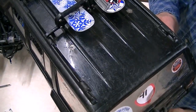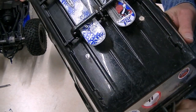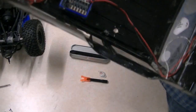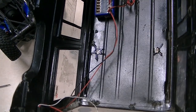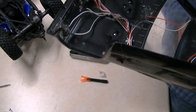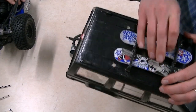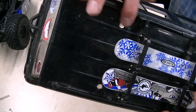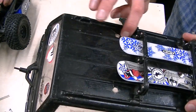Now you can see by the reflection shining off of that hole from the studio lights that there's actually material in the hole now. It's there. And the cracks are all filled in. We've got that Bondic gel all over the place in there, and all it needs now is a little shot of black paint like what we did in the front to give it the color again, and these holes will totally disappear. I mean, they're dry and everything. There's nothing there except just new plastic where there used to be nothing, and that's it. That's the whole job.